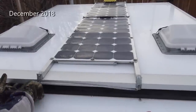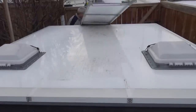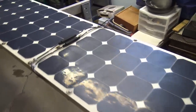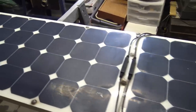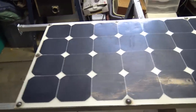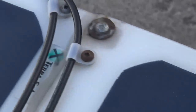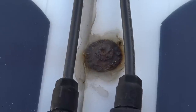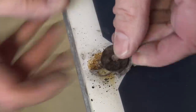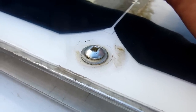Before heading out on a big trip last winter I removed the panels from the roof for an upgrade in the comfort of my garage. The panels don't look that bad — no major scratches — there is a little bit of a blue haze which I'm going to look into, but overall they're in really good shape. One problem that was very apparent was that the adhesive I used reacted badly with the zinc-plated carbon steel washers and screws. After removing them all I replaced them with stainless steel washers and higher-grade screws. No sealant was necessary.